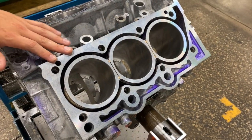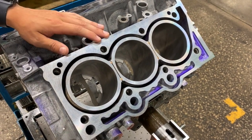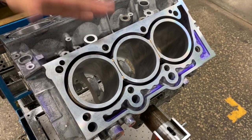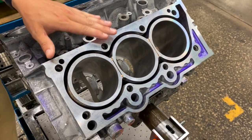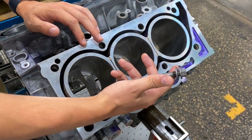The latest newest update is that the block is machined 100% for brand new installation of the steel threaded inserts for the head bolts in the block. This basically overcomes the original aluminum design, which over time has a tendency to pull out with the head bolts.